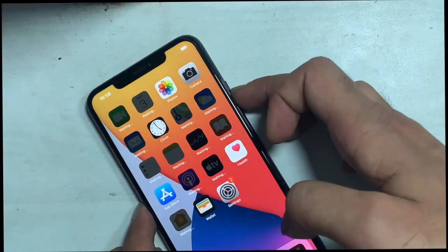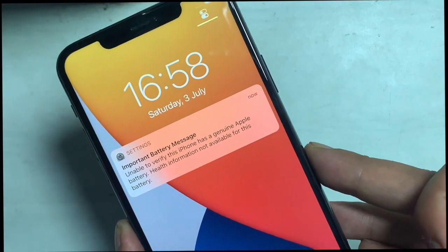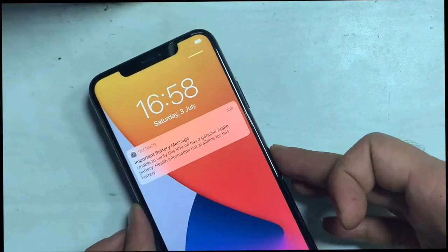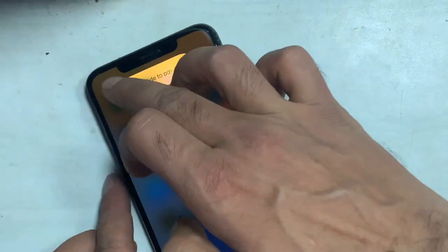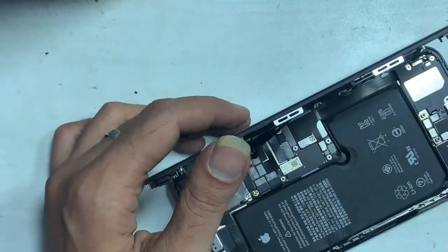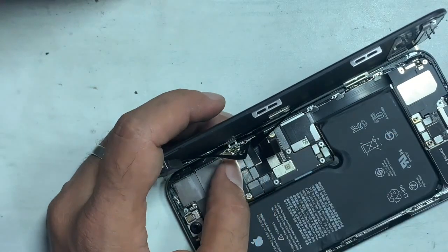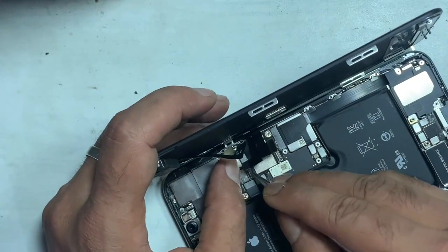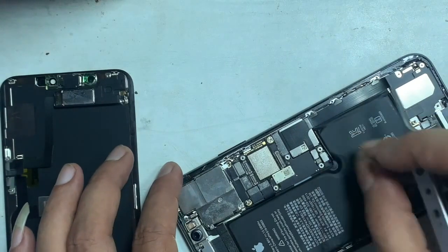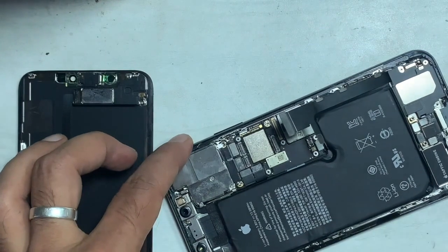This issue occurs after replacing the battery on iPhone XS through 12 Pro Max. Apple has encrypted the battery to discourage independent repair. The chip on the BMS board cannot be replaced. Even Apple authorized service centers or Apple Stores cannot fix that issue easily.